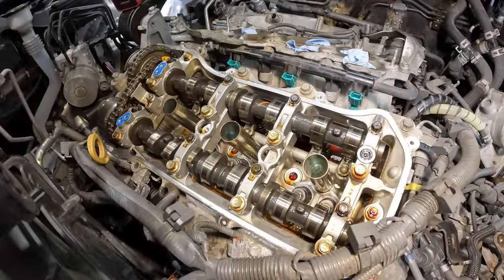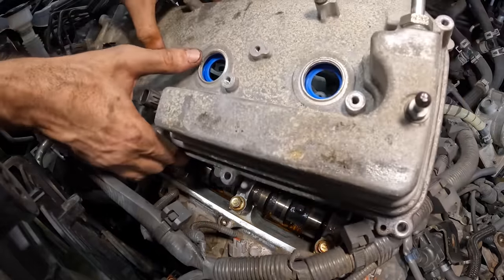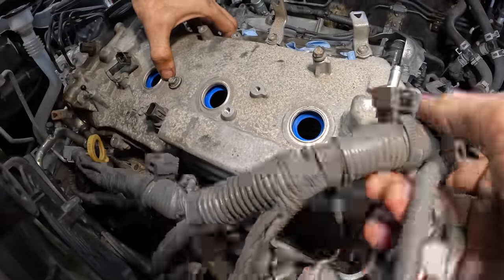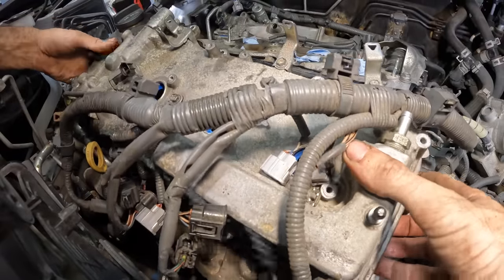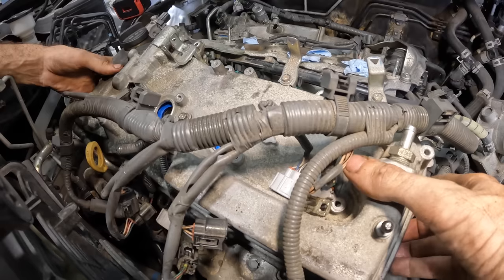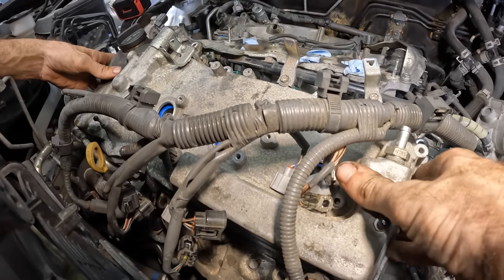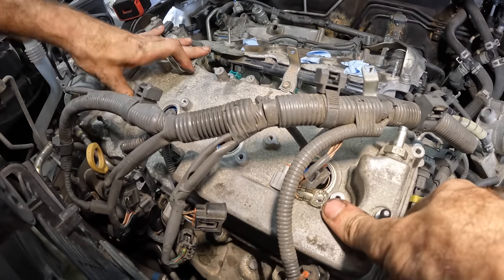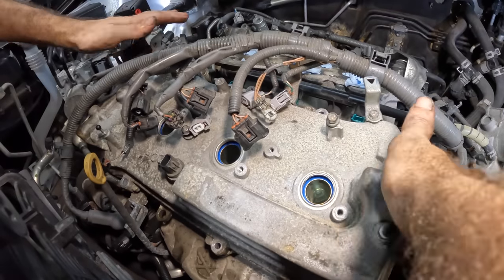All right, cylinder head slash valve cover. Let's get you maneuvered into your home. Minding the wiring harness that I'm about to get stuck. Don't want to do that. And I'm navigating around that oil supply line again. It's kind of a tight squeeze. Slide this over those spark plug tube seals. This is good. Those have seated quite nicely. I think we're there.